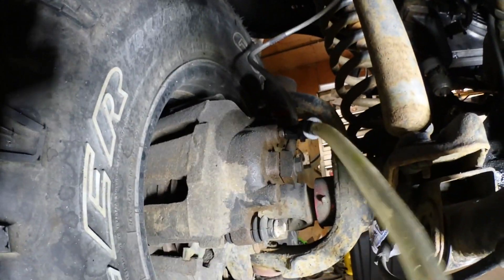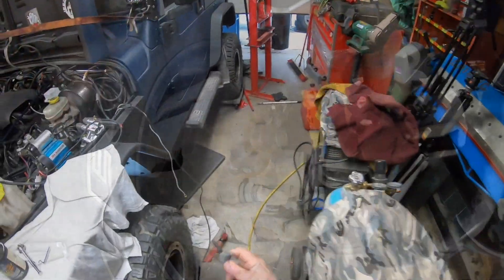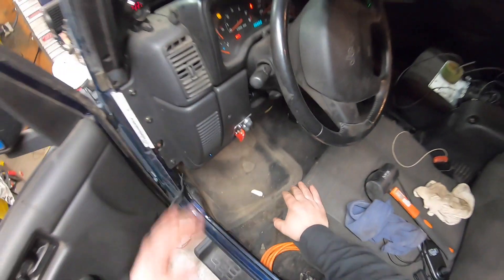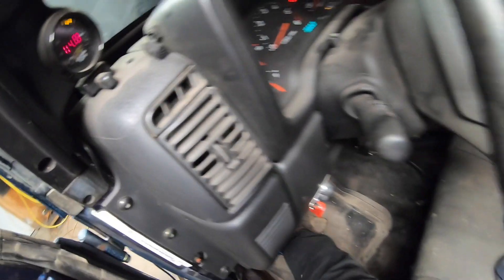Let's pump in some more vacuum. When I pull it off — yes! Start it up, because I should have brakes now and not have the pedal drop to the floor. Nice and tight now — we got some brakes! There you have it. I hope you guys enjoyed this short video of doing a gravity slash vacuum bleed. Sometimes you can get away with doing a gravity bleed, it does take a lot longer. If you have a vacuum pump or attachment, that can make it go a lot quicker, because once you start pulling that vacuum you'll start sucking that fluid down and you don't need two people to do this job. Brakes are good — pump them up really hard. Before, right to the floor. If you have any questions or comments, post them below and I'll see you guys in the next one.